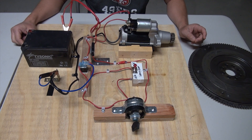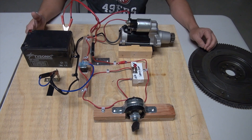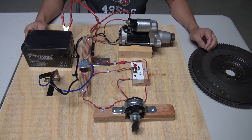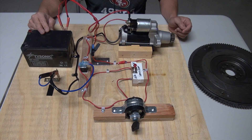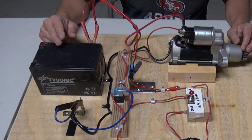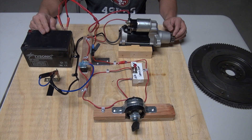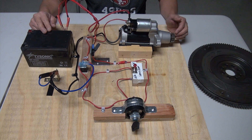I'm going to highlight six major components to this whole system including the flywheel. The first component is the battery. You need the battery to get your engine starting. Without the battery you won't have electricity to start the engine, but also electricity to power all the accessories like your lights, your AC system and so forth. That's why when your battery is dead your engine won't start. Your vehicle battery operates on 12 volts, usually 12 or more but less than 14 volts.